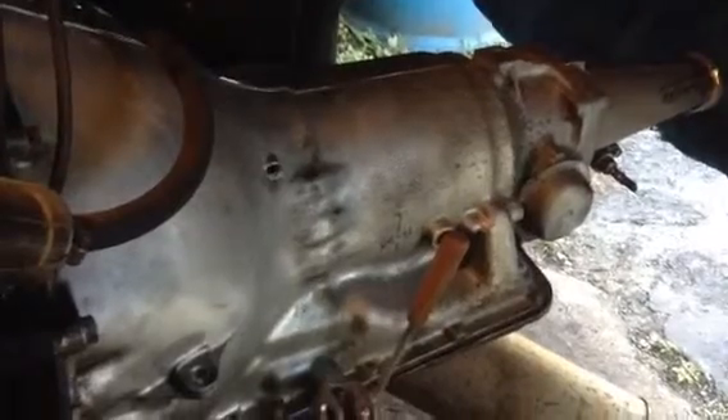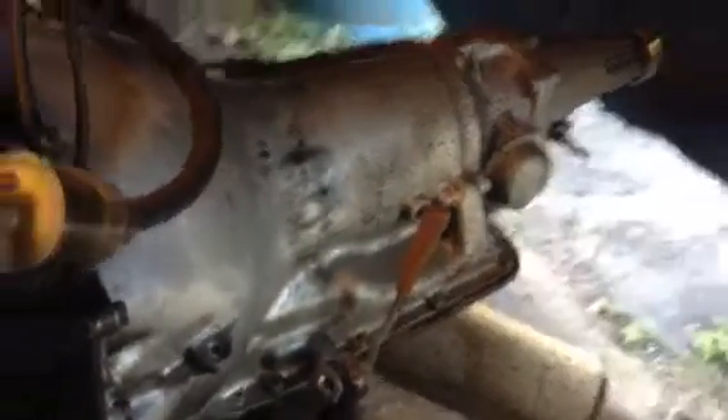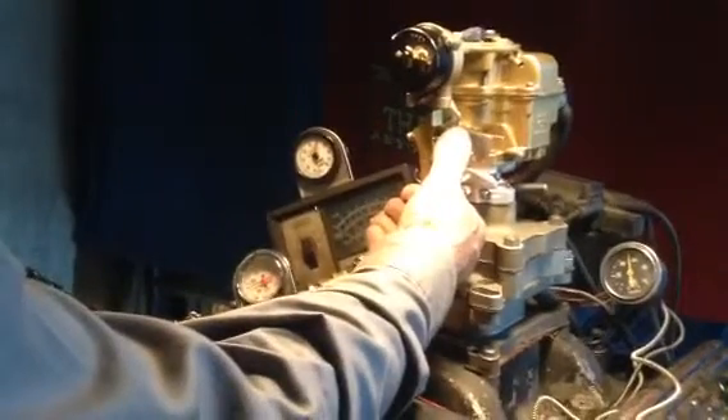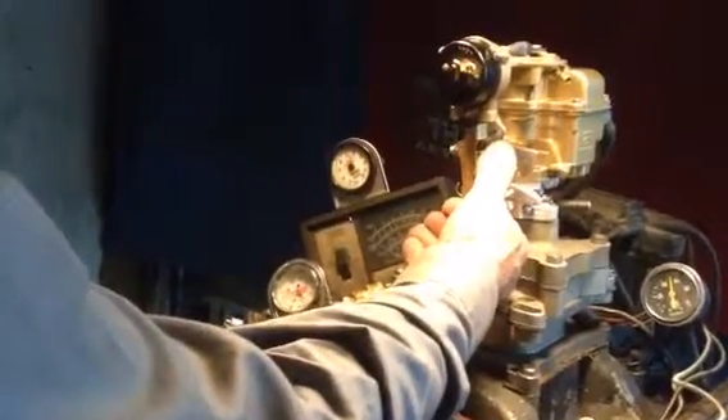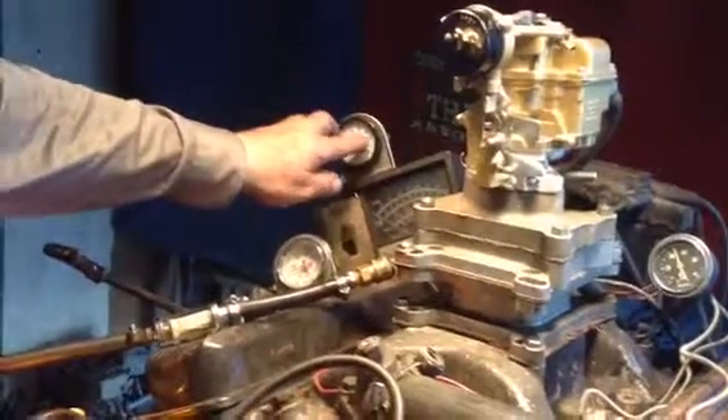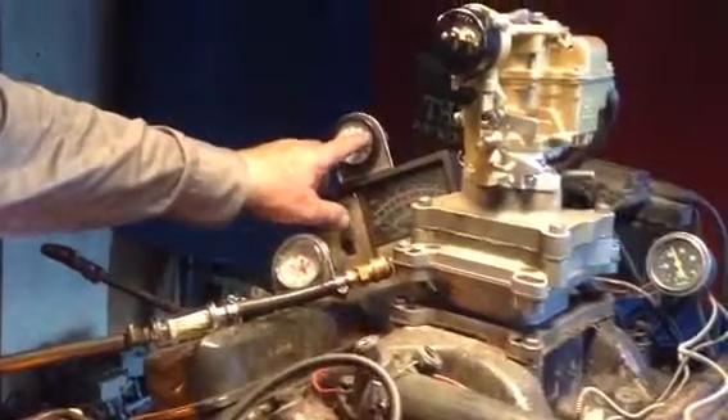Do that by the throttle on the unit. There's a multiplier in there that's gonna start putting a load on the engine. We're gonna watch what the carburetor does under load. On the carburetor right now there's 200 foot-pounds, about 300, 315, about 400-some foot-pounds of torque right there. And you can see the mixture staying well below the tolerance — about 15-point-something would be the tolerance limit. It's running about 14. You can't hardly get any better than that. That is absolutely a perfect, perfect run carburetor.